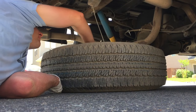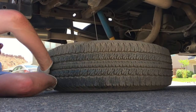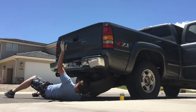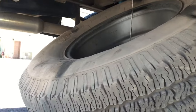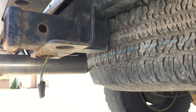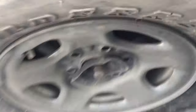Next, as you're reinstalling the flat tire underneath, you want to make sure that you lift the tire up and pull it through vertical, just the way that it came out, and make sure that it centers as you lift it. As we are lifting this back up, you want to tilt the tire so that it goes up first towards the front of the vehicle. The tire is pointing upward towards the front of the vehicle, or it won't come up right — it's the opposite of how it came down. You won't be able to get it to fit up in there unless it's angled nose-up on that far end. Go ahead and crank it and you'll see it fits perfectly. Just make sure that you're centering it on that little wing nut, and you don't need to get it too tight, just make sure that it's snug.